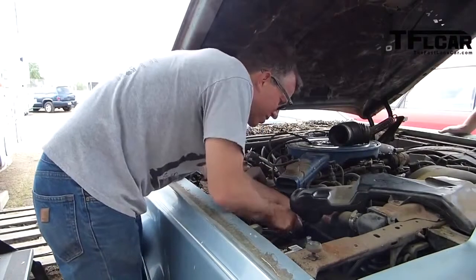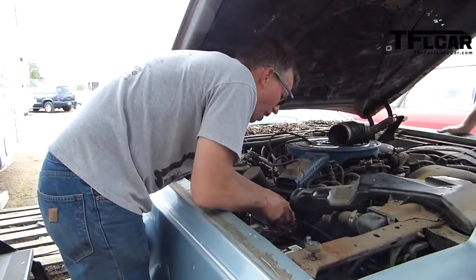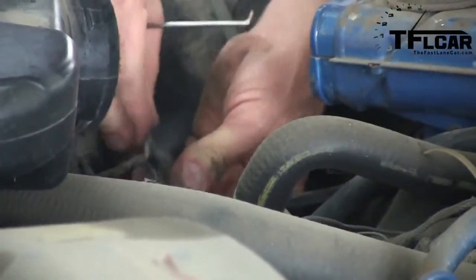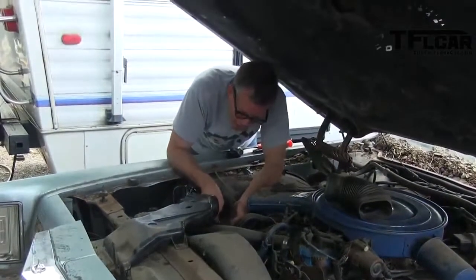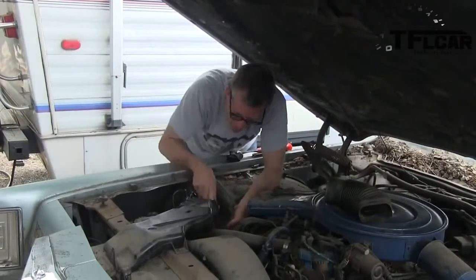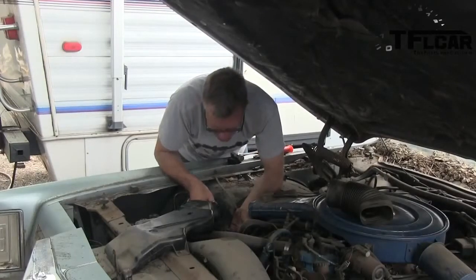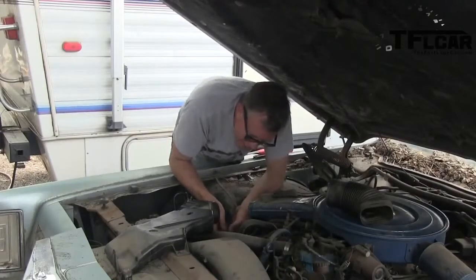now I'm hoping that this crusty looking connection is our guilty culprit, there's kind of a box here, which almost looks, I don't know, sometimes cars would build resistors and things right into the harness. This looks like something I could believe is factory. The only reason I'm looking at it with a suspicious eye is because all the rest of these wires are continuous, and whatever's in here is a mystery to me. So I say we look there first.